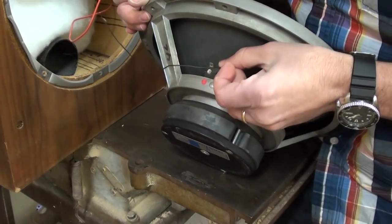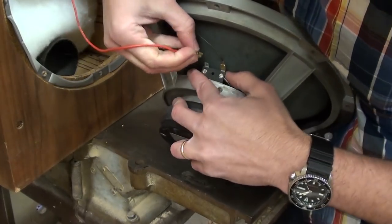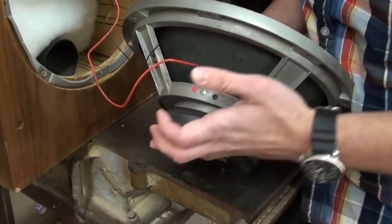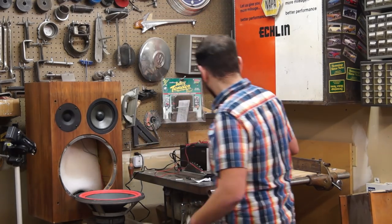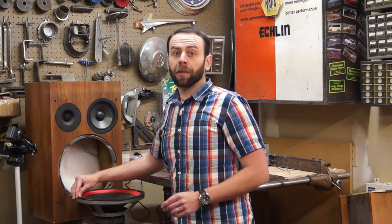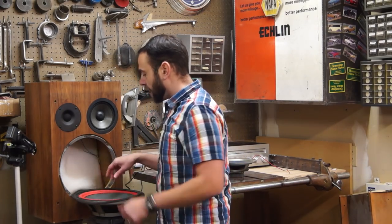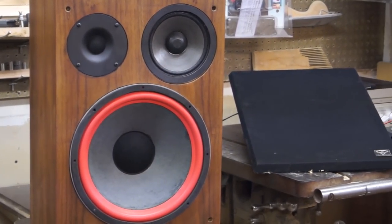This is easy — black goes to black, red goes to red. Push them all the way on. Now we can grab the driver, line it back up, put the screws in, and put this last cosmetic piece of foam on. I think I'll line up the screw holes so they're accessible in the future, because this could be serviced by somebody another 20, 30, 40 years from now. And we'll be good to go. Thanks for watching — I hope that helps you figure out how to re-foam and keep using an old speaker that has tons of life left in it. Thanks for watching. Bye.